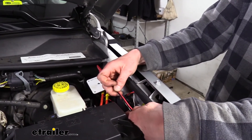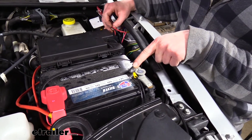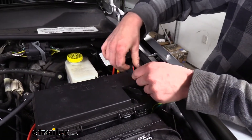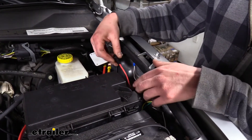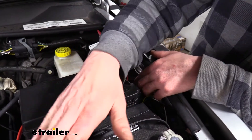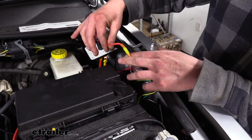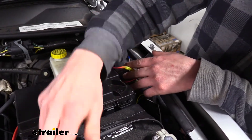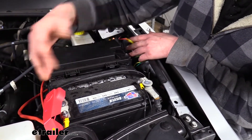The red and black wires from the other harness are your power and ground wires. The black wire we routed to the negative post on our battery, attached a ring terminal, and connected it directly to the battery. For the positive wire, we need to add the included fuse harness to protect the circuit in the event of any shorts. This comes included with your kit and you'll want to hook it to the battery positive post. Our customer has a battery disconnect switch pre-installed, so we hooked our power to the side of the disconnect switch that always has power — as long as this circuit always has power, you are good to go. I highly recommend going directly to the battery positive post with a ring terminal if you don't have a disconnect switch.